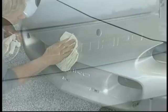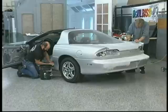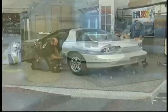We now begin the sanding, and you can use 280, 320, some painters even use 240. Now we use the DA sanders. Basically, we like the Hutchins vacuum type sanders because they keep the dust to a minimum. The sandpaper lasts much longer.